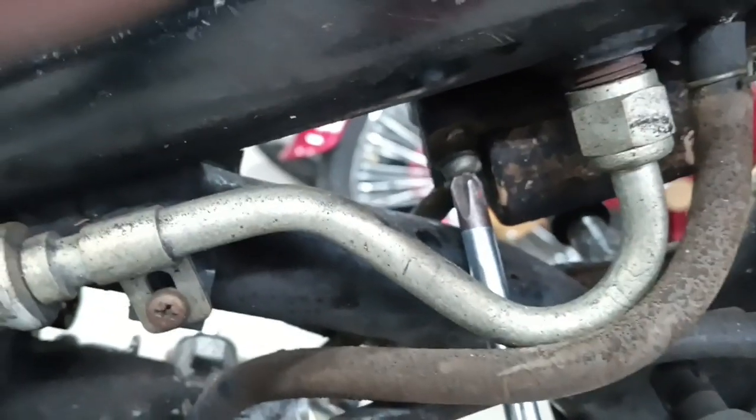I'm telling you, if you're cussing your Japanese motorcycle because your Phillips screwdrivers can't get the screws out, stop what you're doing and get yourself a JIS screwdriver — a set of them. They make these things come apart so much better.